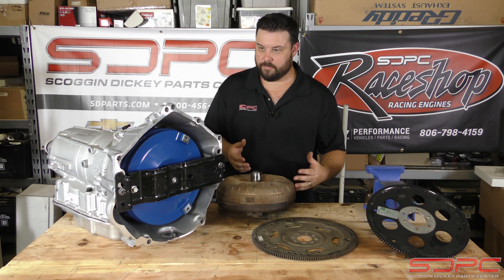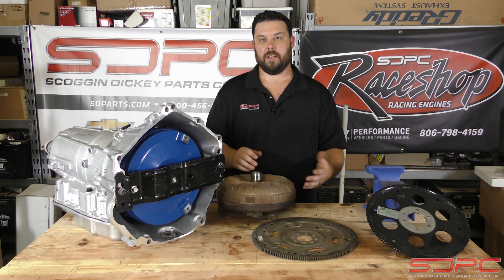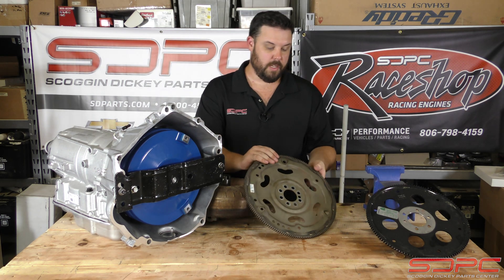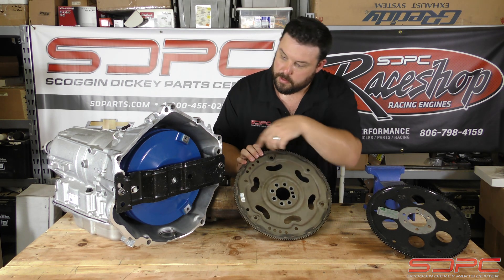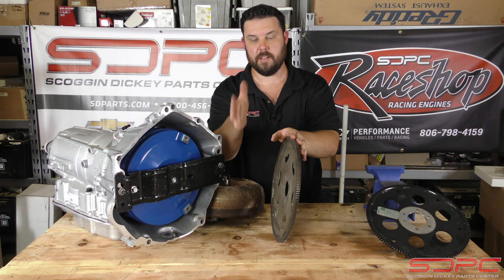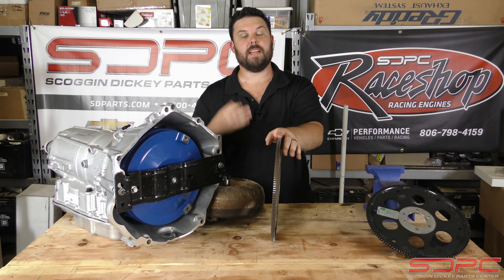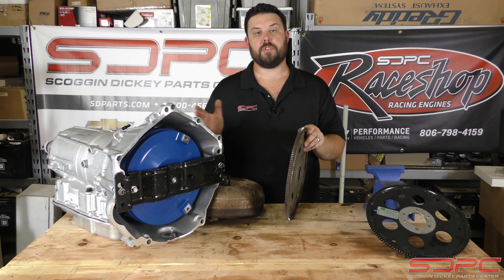If you've gotten to this point, you're like: okay, you told me what not to do, you told me how to stab this stuff, you told me I had to take it apart if I did it wrong the first time — Nick, what am I looking for when I finally put this thing together? That is a good question. What I have here, regardless if it's an aftermarket flex plate or the stock flex plate — specifically this is actually for one of the Gen 5 LT engines we're working on out here — what you're looking for is engagement of the boss here on the flex plate and the mounting boss here on the torque converter. This is a big deal. When this transmission is nice and hand-snugged up against the engine block, the gap in between these two surfaces needs to be about an eighth of an inch, and it can give and take just a little bit. But it's like that for a reason — it's enough to where it won't pull out of the torque converter pump, but it's enough to balloon and expand with heat.